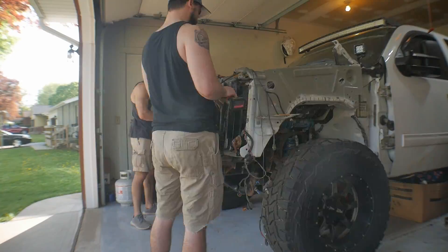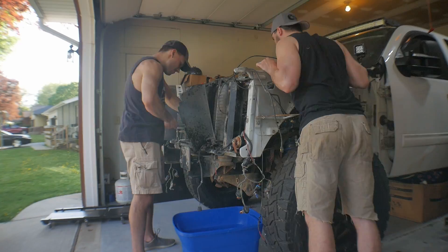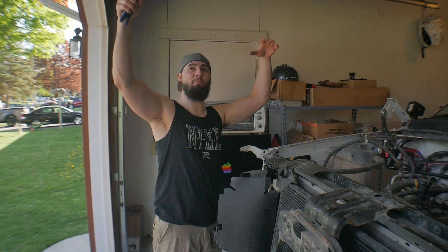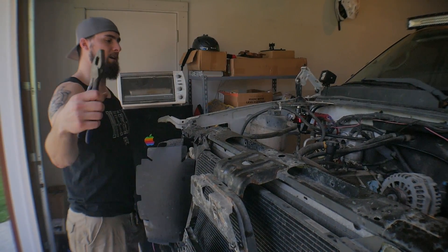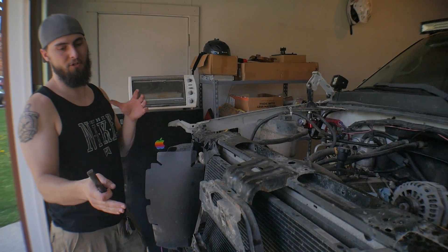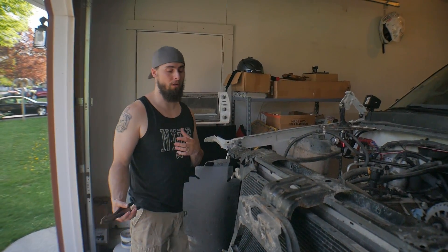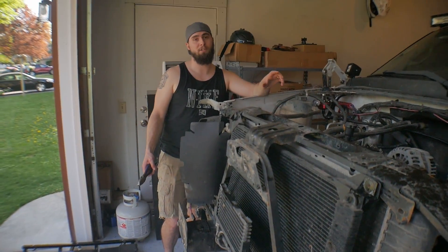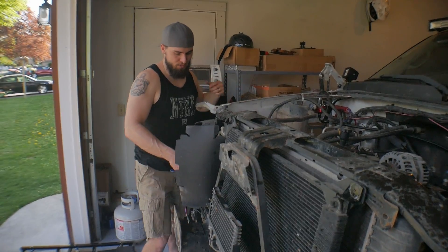Because of how tall the truck is and how low the clearance is above me, in order to get the actual hoist in and out of here we're going to go ahead and drain the radiator, the heat exchangers, transmission cooler — everything — so we can pull the engine straight out the front. I got a big bucket here. I lost a bunch when we took one head off but I'm sure there's still a lot in there.